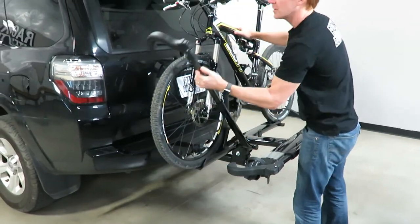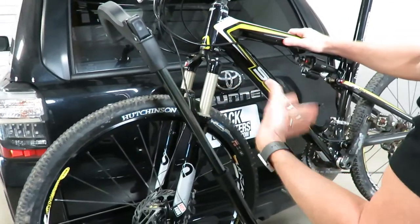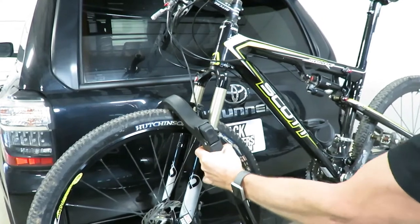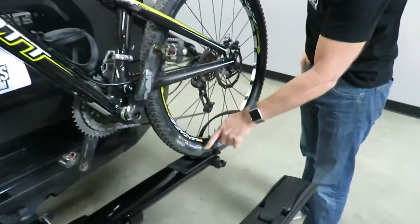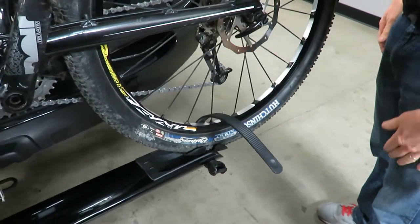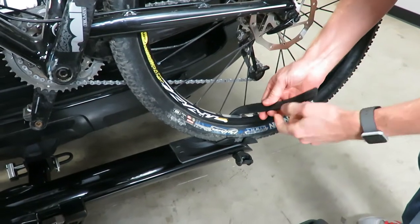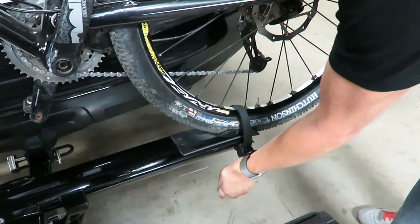Lift up on the arm and bring it down as close to the first point of contact as you can without actually making contact, then pull down as snug as you can for a good firm grip. Make sure it's engaged in the wheel cradle nicely. On the back, the rear wheel sits in a pivoting rear wheel tray — no adjustments necessary, it automatically pivots to line up with the rear wheel. Run the strap through the buckle; the ratcheting strap is strong and rigid, but has rubber on the underside to protect the rim. Insert it and pull it snug.